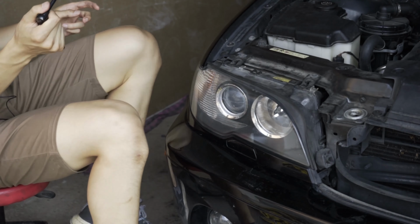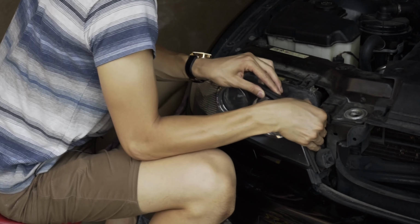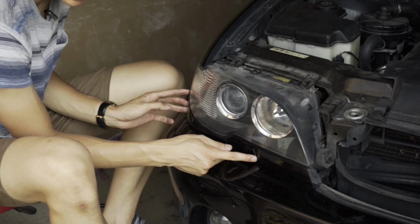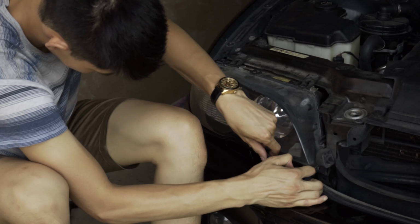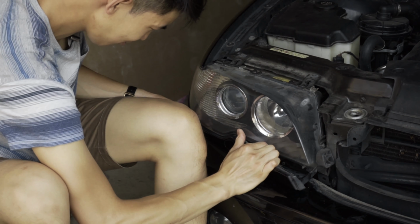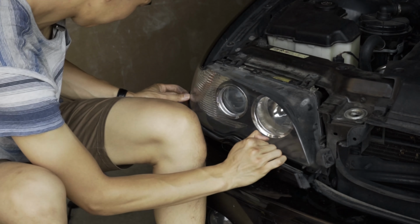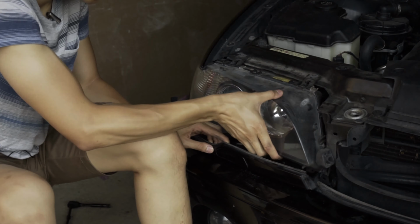All right, first things first, to get the headlight out, we're going to remove this little weather stripping here. It wants to come out. And this bottom one, mine actually has the headlight washer upgrade, so I think I'm about to make a mess. There's a little tab there on the first side, and I think the rest is supposed to just come out. No idea how to disconnect the water. Honestly, I think that's good enough. I think we can start removing the headlight around it.